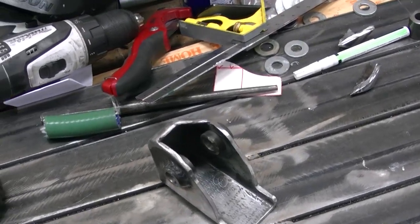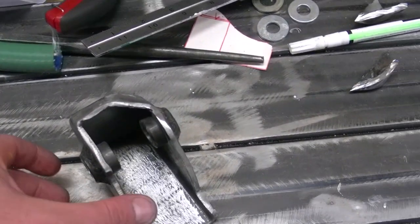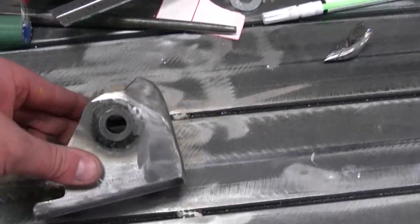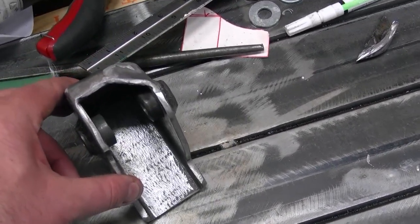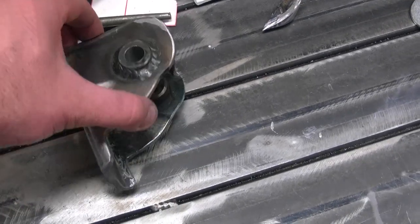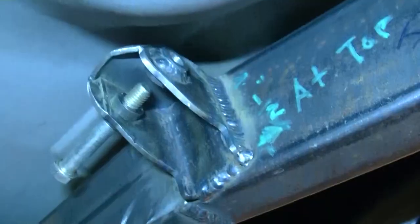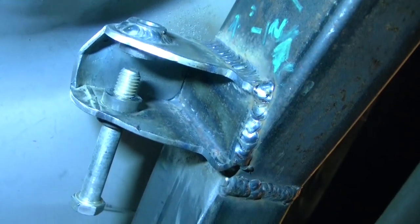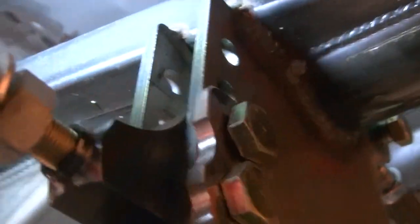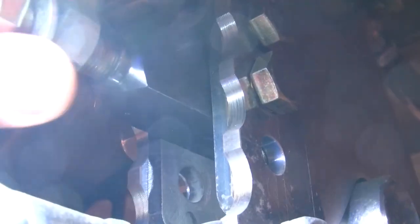Here is our final product for the coil over. We have the other one welded in place — forgot to record it — so we got this one recorded before we get it welded to the frame. Notched out right there to clear the trunk pan, it's ready to go in. There's where our coil over bracket is welded to the frame. You can see where it was cut out to clear the trunk floor. It's all been repaired and ready to drop the coil over in, which then bolts on to our rear end with this little bracket we bought.